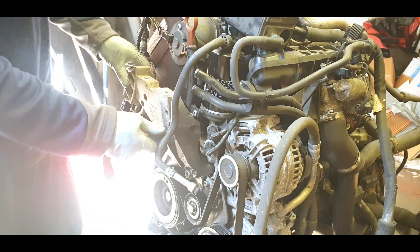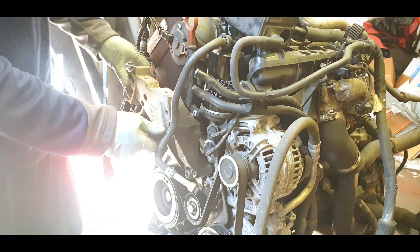So we've prepped this up and it's ready now. These three go into the engine mount and I've put all the wiring back. We've done the timing chain, put the seal back in, and put that seal back in the cover. I've not touched anything here guys — once you open this up you're going to need injectors sealed and everything, and I don't need to do any of that because it all seemed fine. Before we put it all in, I'll just check all the gaskets are in place and all of these little clips are here. That goes back into the bulkhead — all the gearboxes on, the starter motor, the wiring.